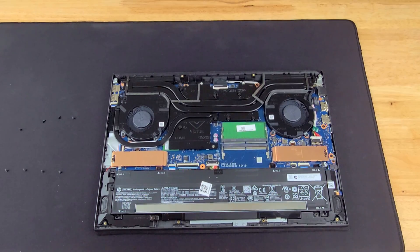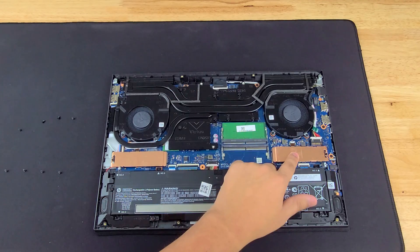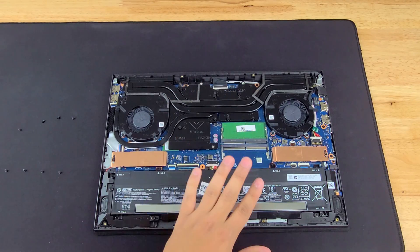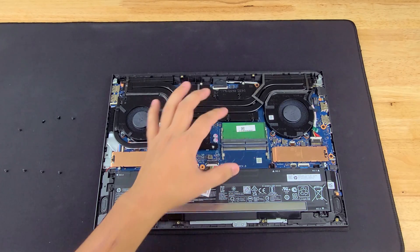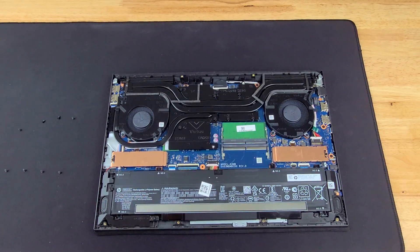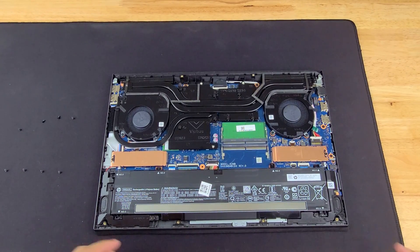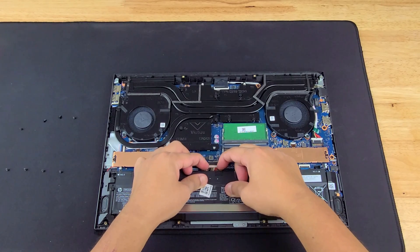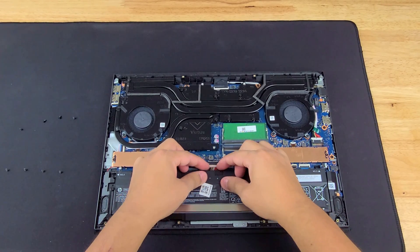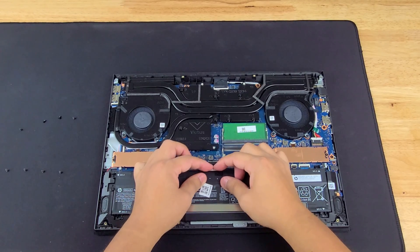So let's get to the laptop here. This is going to be your two RAM slots, and this is going to be an NVMe slot, another NVMe slot, and your battery. In today's upgrade we're actually going to be just changing the RAM, but I'm still going to show you how to take out the NVMe just so you can see that. Before we get started, let's make sure that we unplug the battery because we do not want to be working on anything with power. The battery connector is right here — I'm going to take both fingers and pull downward, and that's going to pop right out.